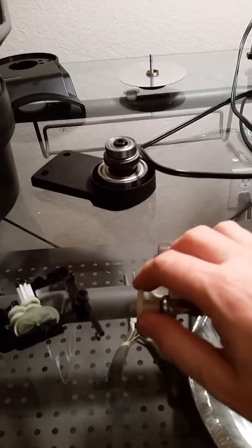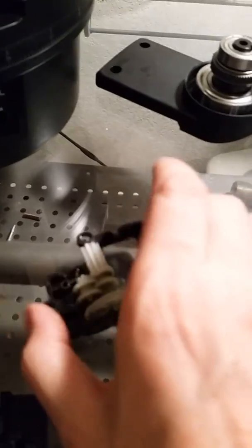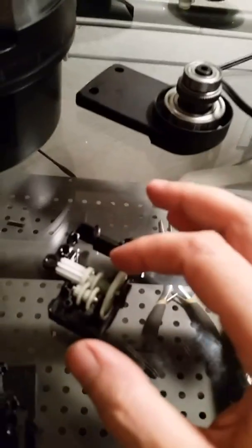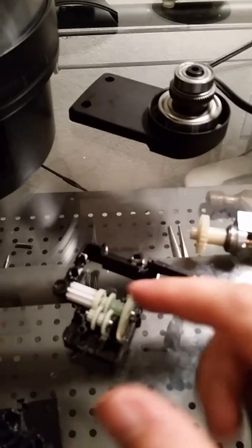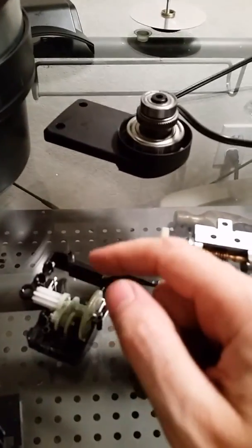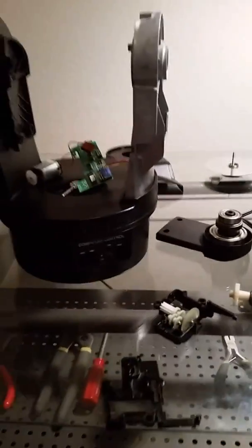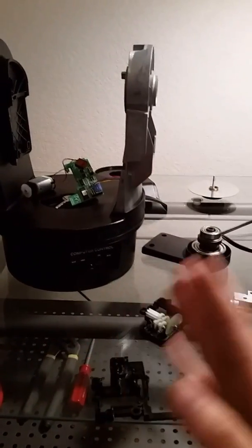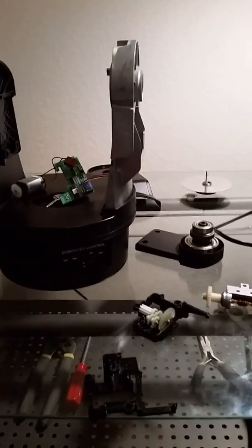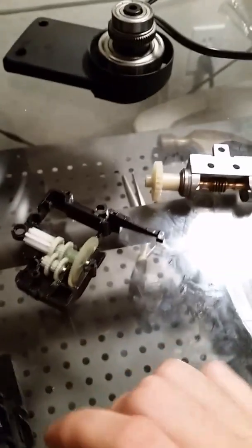Pulling out all the gears was not that hard at all. Just be mindful of these little guys — they have some grease on them. If the telescope has been sitting around for a while, the grease may have pooled in one area of the teeth, so spread it around. Every now and then, take the telescope out and drive it around — move it left and right, up and down — to get that gear oil on these tiny nylon gears. Just be careful because they have little axles in them and they're precision set.